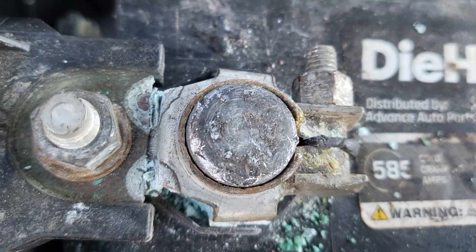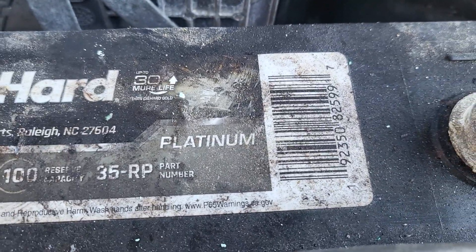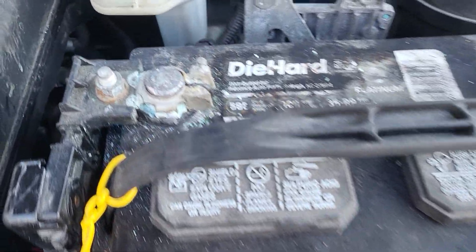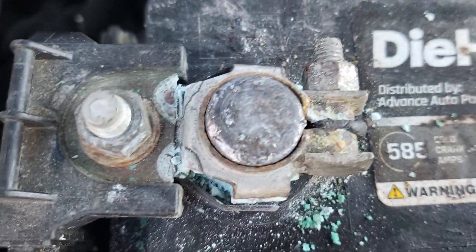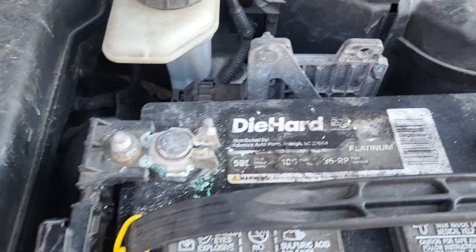Please clean your battery terminal always — clean it from time to time. Don't wait. This car had to be towed more than a couple of times; sometimes it starts, sometimes not. With the alarm too, it creates a voltage drop so the VCM doesn't want to send a signal out. Thank you for watching — please subscribe, share, and like.